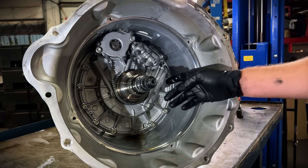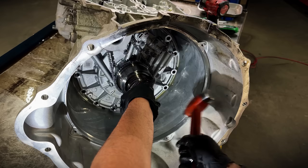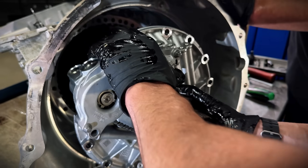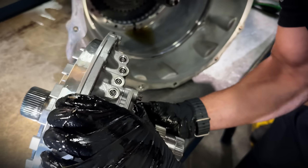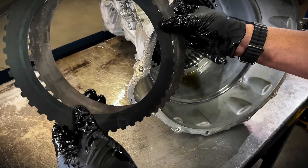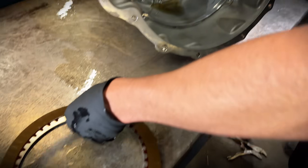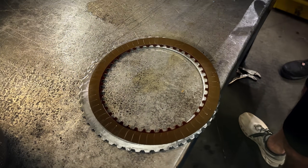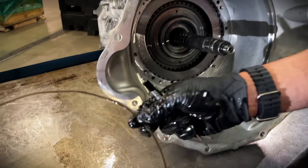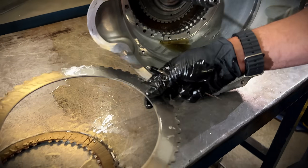Something a little different we're not used to here at Randy's — a remote chain-driven pump. They probably make a tool for this, but a good old 6L 'smack the stator' trick gets it out real easy. Now digging into the meat and potatoes of this transmission, we're looking at the B clutches here. They seem to be pretty beefy — we're not going to have any issues with these failing. We also have anti-drag wave rings in here to keep the clutches from dragging after they release.